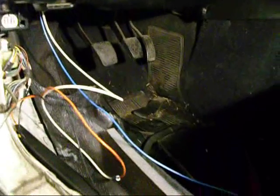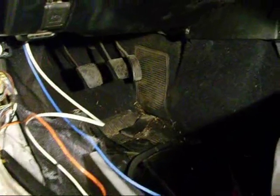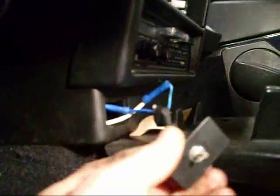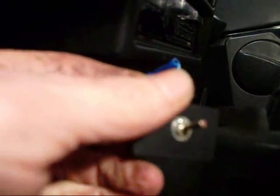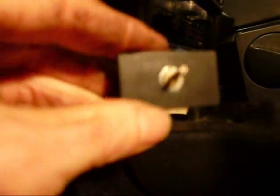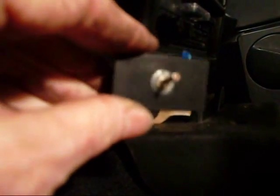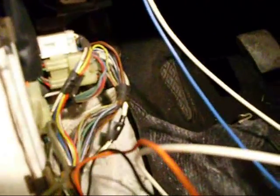This is the 1986 Toyota MR2 that we've been working on. The alarm system was not allowing the car to be started sometimes, so we decided to remove it all but retain one of the switches — a little toggle switch — which we're going to use to control the fan in the engine compartment. That fan was supposed to be controlled by a thermistor that Toyota was not able to locate and was just not reliable.